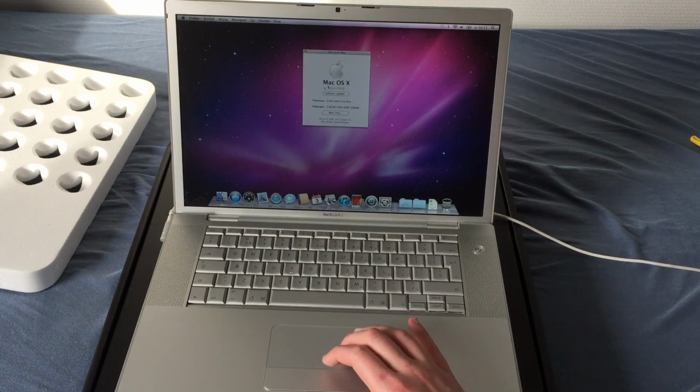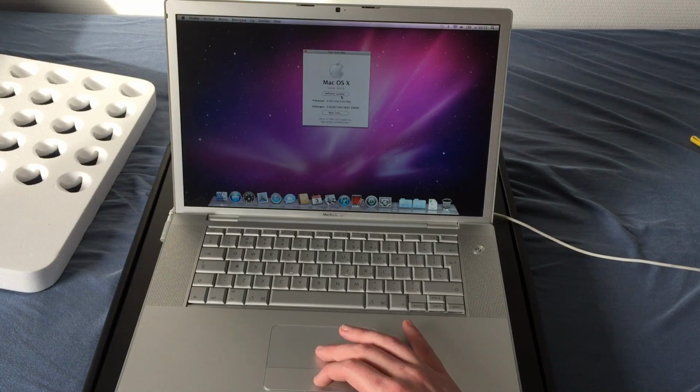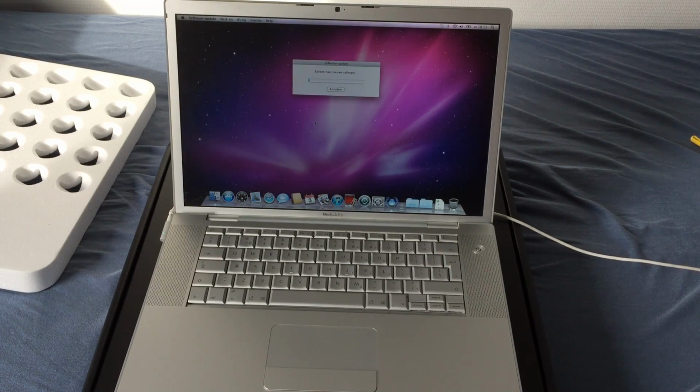I don't think this is updated yet. It is on 10.6.8, but I don't think this is actually with an updated Safari, because it should have like Safari 5 or 6. I think it's Safari 6.1.4 or something that it should have. And that loads pages just fine. And even if you just install the last version of Chrome that will run on this, or Firefox ESR, I think 42, those run fine on Snow Leopard. So that should be no problem.